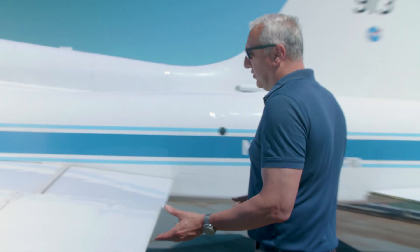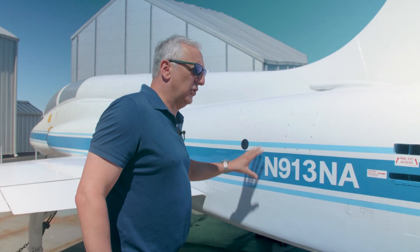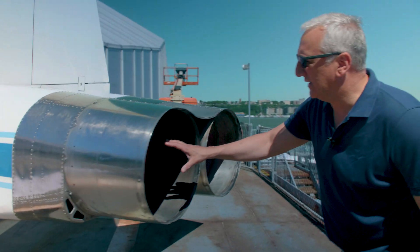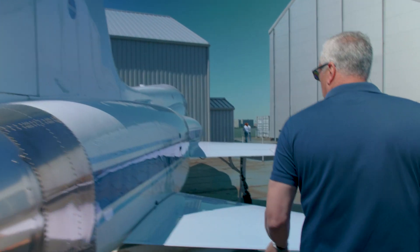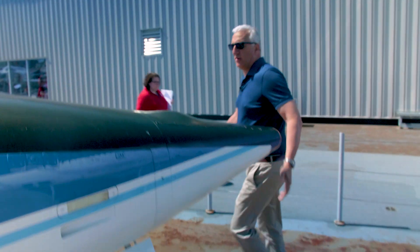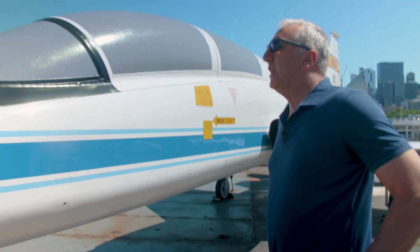Make sure the brakes are working. Check the control surfaces — they move around a little bit here — make sure they're movable, and check that you have a good amount of hydraulic fluid. This control surface here, we call it the elevator; make sure that's movable. In this case it actually is, so that's good, even though we're not going to fly this airplane today. Looking back here at the exhaust, make sure everything's clean and clear — you can see all the way through. Give the rudder a little shake, make sure the elevator is okay, check the hydraulic fluid. Everything looks good, everything works, nothing's loose, nothing's leaking. Check for leaks, and then you get inside and go flying.